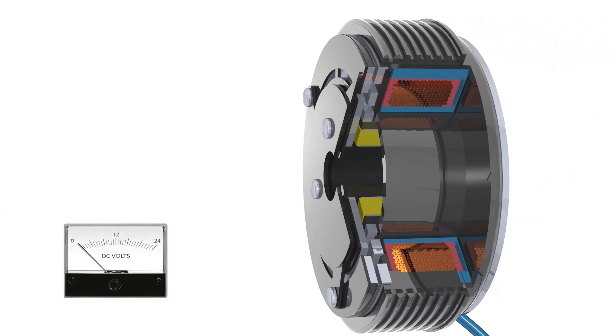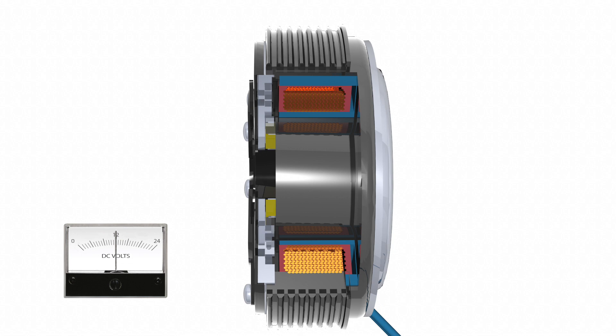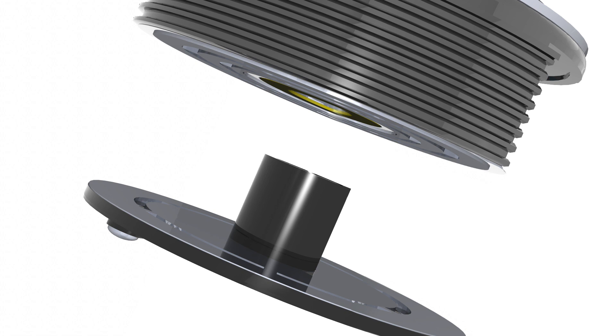When the current voltage is removed from the clutch, the armature is pulled away and held in place by the leaf springs, creating a small air gap so there is no contact. In most mobile clutches, friction material is not used, and contact between the armature and the rotor is steel on steel. But in some special designs, friction material can be added to increase the contact area for high-speed engagements.